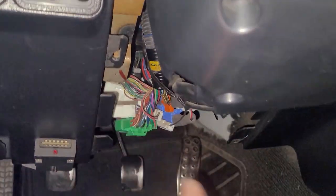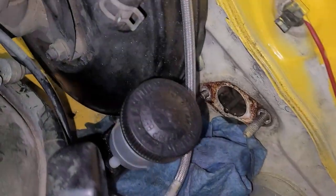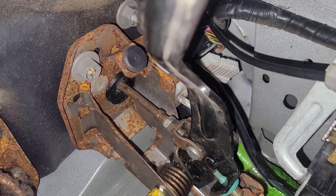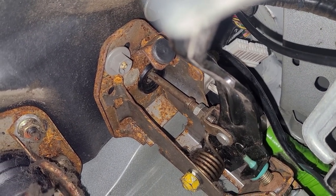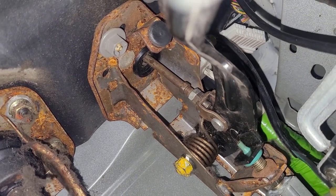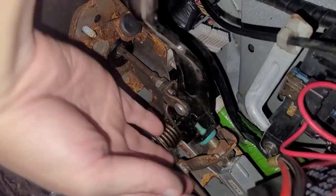You should go ahead and remove this little plate — it's like four screws. And then take these two nuts off here, and then this guy will just slide straight forward. We're going to disconnect two electrical connections down here and remove a plastic nut and then a 12 millimeter bolt. I can tell you right now, this has got to be the plastic nut and I can just spin it with my hand, which is great.